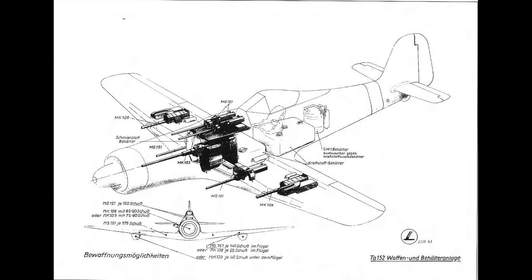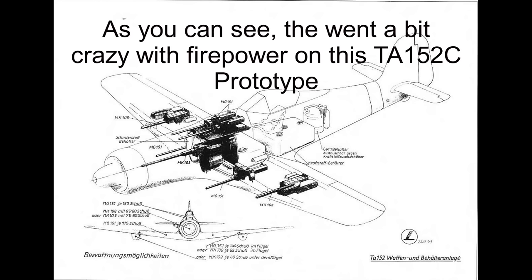The second problem, and this one isn't a big deal, but the pressure in the tank will decrease as the oxygen is used. Thus, a regulator is needed to ensure the quantity of flow remains constant. This is easy when it's a person breathing, but it's more difficult when it's a 2,000 horsepower engine because the rate of the pressure drop in the bottle is going to be tremendous. Injecting nitrous oxide solves these and other problems.